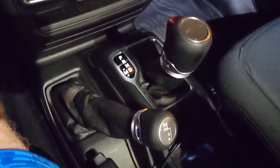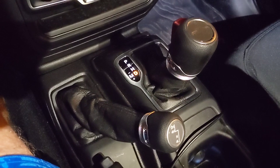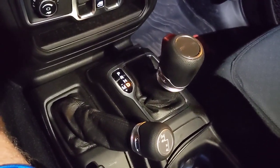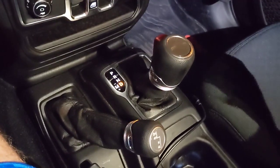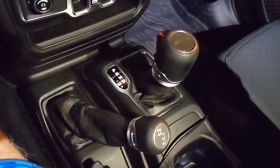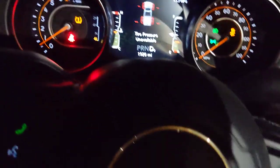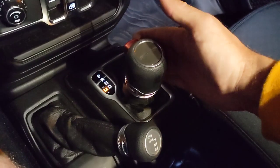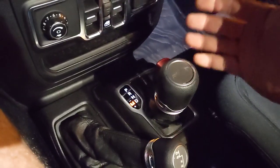When you're in drive in four-wheel low, you have a really good brake LSD. Basically it uses the brakes front and rear to give you some sort of locking differential action, and it's great — it makes this truck ten times more capable when you've got one front tire and one back tire in the air. However, when you're in sticky thick mud it will limit the throttle to about 3,500 RPMs in first gear and it won't let you clean your tires out if you're in drive.